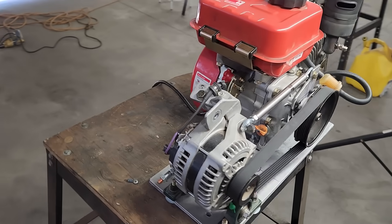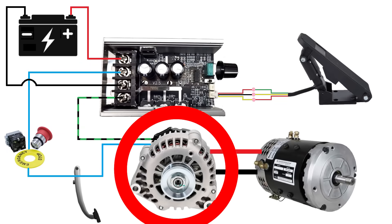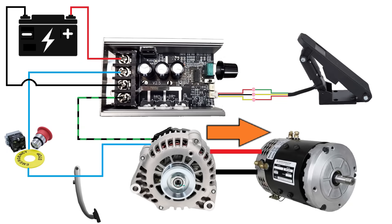Today I'll give a brief description on how we're able to get an electric golf cart to move without using batteries. This alternator is directly connected to the electric drive motor in the golf cart. There is a forward reverse switch somewhere between the alternator and the motor. The alternator is used as a source of power, and here's the neat little trick — we're also using the alternator as a DC motor controller. So the alternator has dual purposes: it's a power source and a DC motor controller.